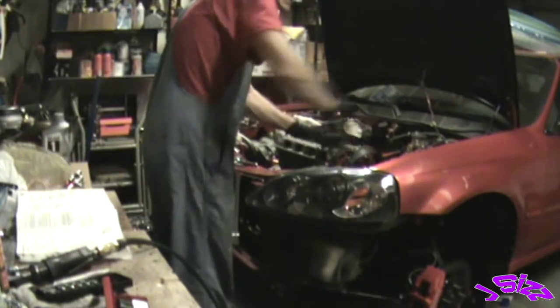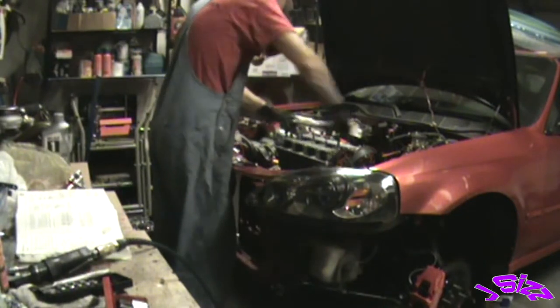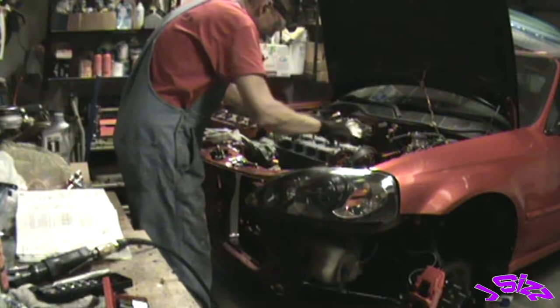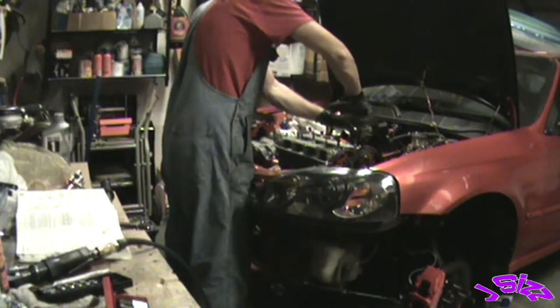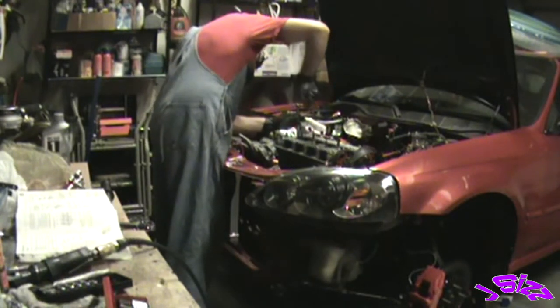Hopefully when I go to the one and two there in order, it tightens it down and then creates a little bit of space there to get me back in sequence. Let's do the outside ones last because they're a smaller torque, so getting the center ones torqued to spec will get the final resting place of the outside bolt. It's 7.2 pounds, so it's almost there by hand. I'd say that one feels like it's pretty darn close.